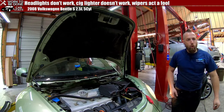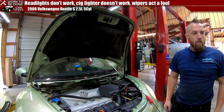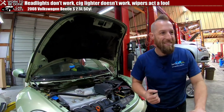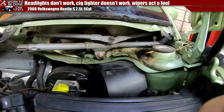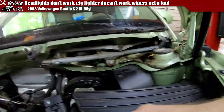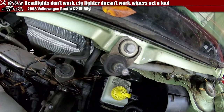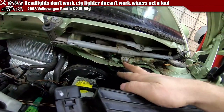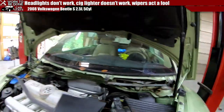I think she was shorted out on all that crap under there. Either that or it was a bad connection. Look at us. We're so good! So, working great right now. Doesn't smell like burning motor. Our wipers are just wiping away. Wipe, wipe, wipe, wipe, wipe, wipe, wipe. Yeah, I would go with it. This was so packed with crap, leaves, and debris that when it finally rained, the rain got up there and shorted out those wires.